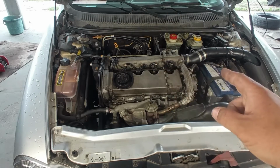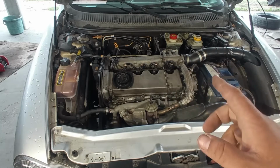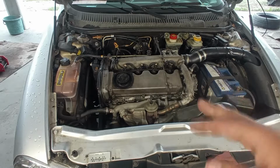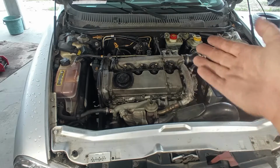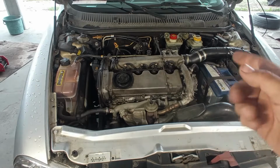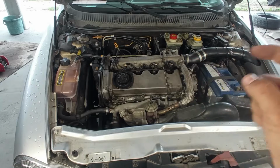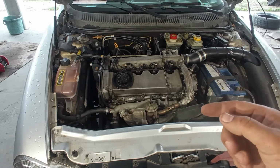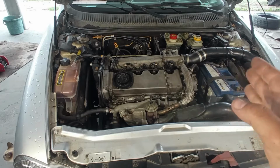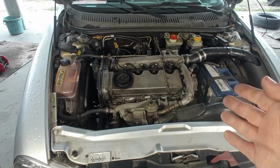I will start here by checking the compression like I said, because a bad compression can do this, but okay, one step at a time, okay? Which means now also that we had a problem with the sensor, the bad fitment of the RPM sensor, and I can hear that the starter does not pull back and is constantly spinning with the engine. So this will destroy also the starter. Okay, I already have a lot of videos for starters. If you want me to do one for this one, I can do it, okay?